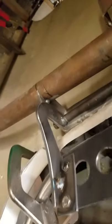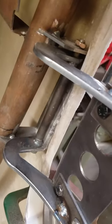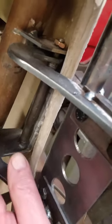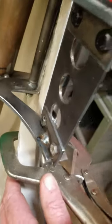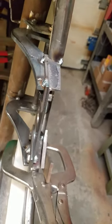At that point, I've got my hinge, and you can see that this pivot point on the hinge is as far out as I can get it — as close to that outside skin as I can get that pivot point. What I'll do to get that pivot point out as far as I can is I'll make this hinge bracket in a configuration that fits the cowl hoop, and make it as far out as the bodywork allows on that car. So you can see looking inside my door hinge, the upper and lower J-plates and the rectangle plates that bolt it to the door hinge plate. At this point we've got the front end of this mocked up, shimmed, lined, and then we're ready to start tacking this stuff together.